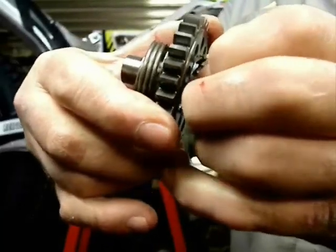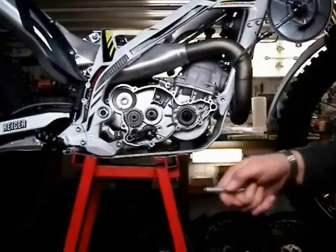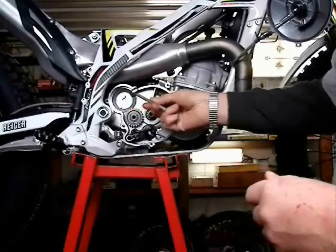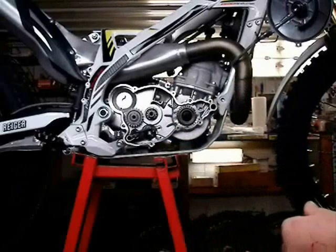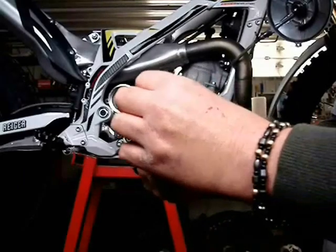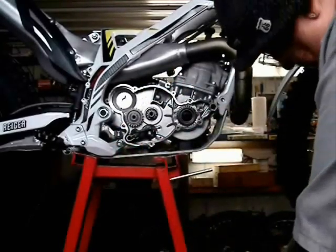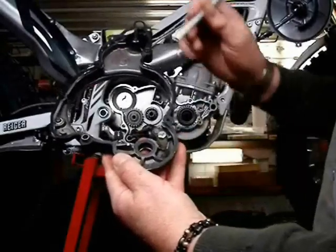The two gears that face each other have opposing teeth; when they're separated they're not engaged. The interior thrust washer can easily be stuck to the cases because of the oil — it may stay there, and then over a little bit of time gravity may pull it loose and it may drop on your workshop floor. When you take this apart, find those two washers and make sure they're back on your kickstart shaft assembly. The other one will usually be found stuck to the interior of the clutch cover — this is common.